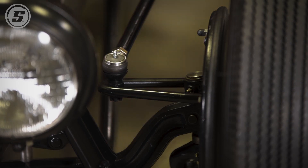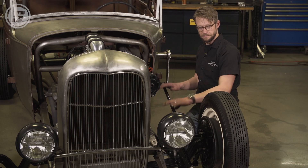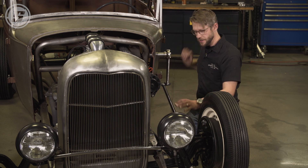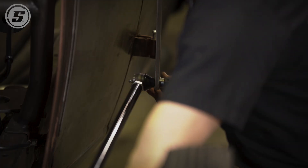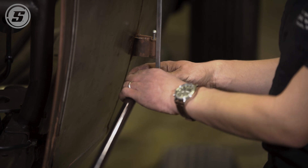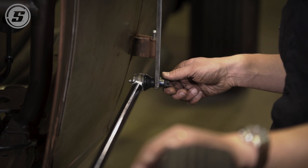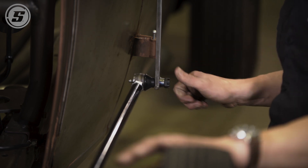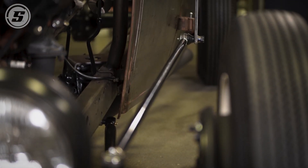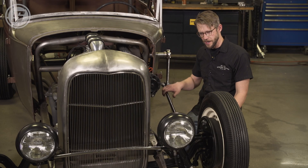Normally to finish this installation you would tighten up these jam nuts once you had your alignment set exactly the way you want it and your wheel made sure to be straight. Then you would lock down these jam nuts. You would tighten these castle nuts really tight to pull that taper in and press it in place. And then lastly you would put cotter pins in the castle nut to hold them in place. All very important — this is all really critical to the safety of the car. But we're still welding up all of this stuff on the pitman arm here so we're not going to lock this one down yet.